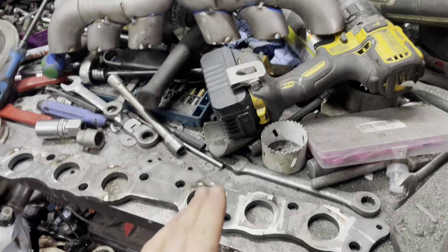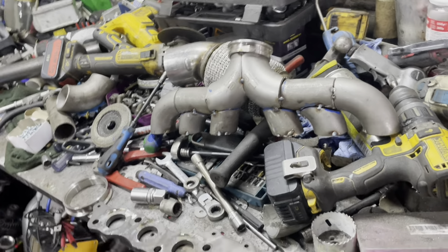The manifold is off again and I'm going to start welding it up now. I was going to use the TIG welder but I'm just going to MIG it. I could TIG it and it would look prettier, but I want it strong and fast — we don't have a lot of time. The MIG is fine for this job, just maybe not as photogenic as a TIG weld. Once it's all MIGed we'll bolt it to the car and weld as much as we can in place, using the head as a heatsink to stop the flange from warping.